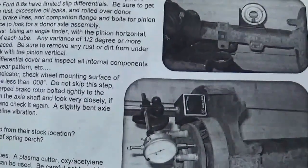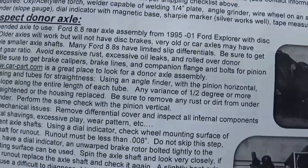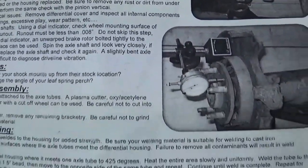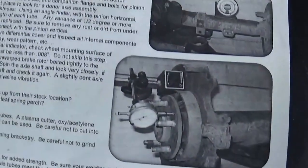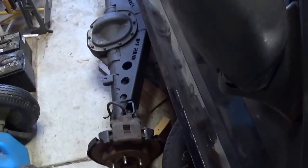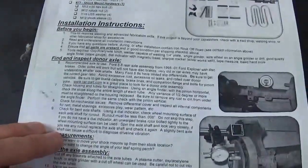very sought after. Like mine, it's got a limited slip, like they state. Most of them have limited slips, and either variation from 355s to 410s. I got 373s is what I have in that rear end. And I thought that's what the Jeep had, but it actually has 355, so I'm changing the front axle too, but that's in another video.